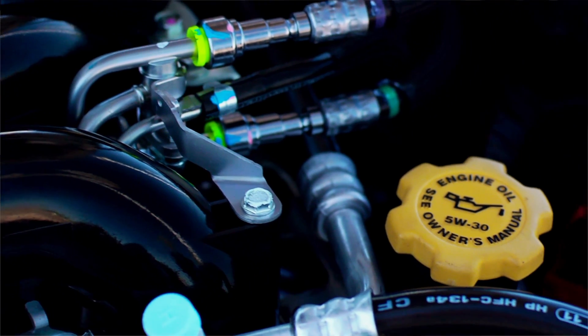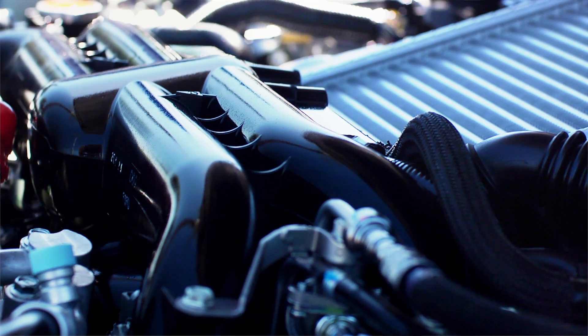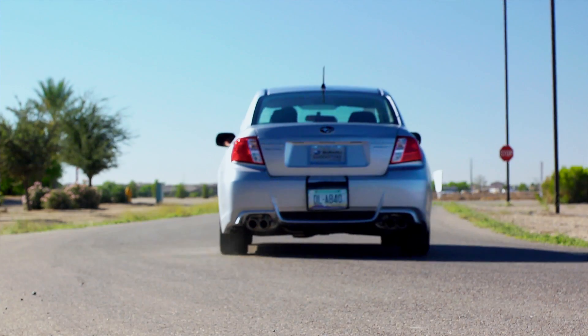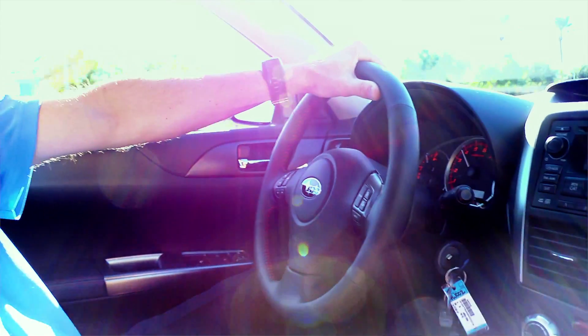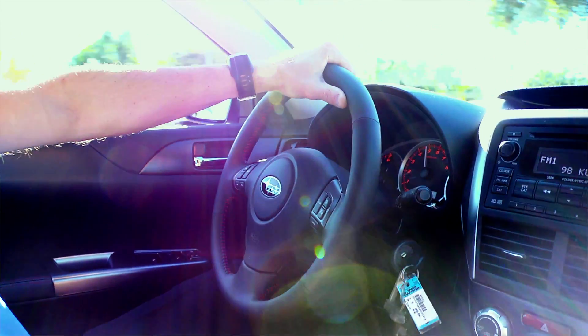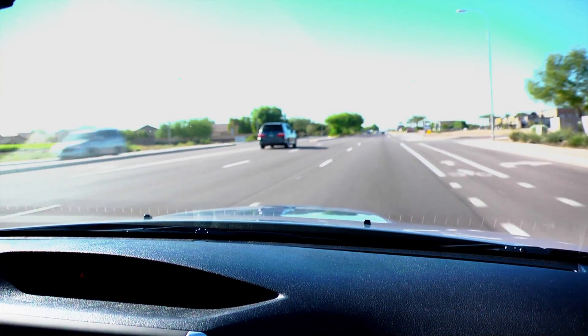With active valve control, the turbocharger with intercooler has a maximum boost pressure of 14.2 PSI. It is 265 horsepower at 6,000 RPMs and makes 244 foot-pounds of torque at 4,000 RPMs. Fuel economy is rated at 19 city, 25 highway, and 21 combined MPG.